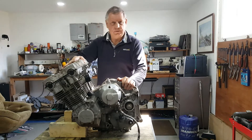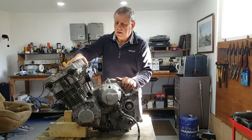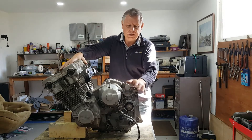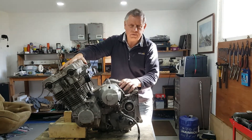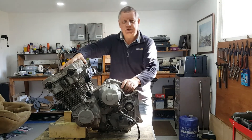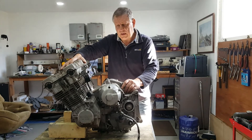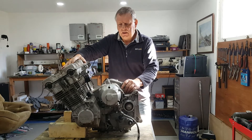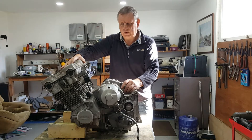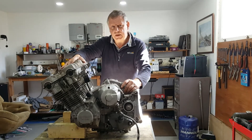There's no point doing half a job — it's going to come right away apart and I'll be replacing all the components, gaskets and seals as I go. As a starting point, last Friday I put the head back on with a few securing nuts and the rocker cover back on, and degreased it. The reason for degreasing is not the grease itself but the grit that it absorbs. So I've degreased this engine and used detergent to wash the grease off, and now we're at the starting point of pulling this motor apart. I'll be putting parts on time-lapse and stopping to share anything worth noting.